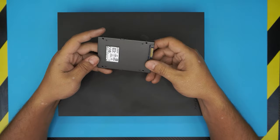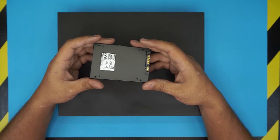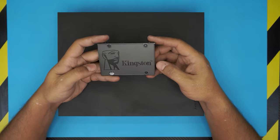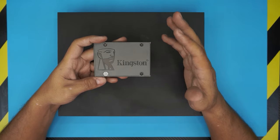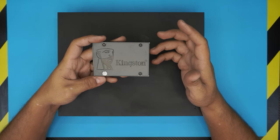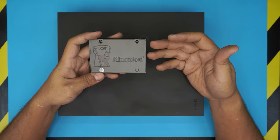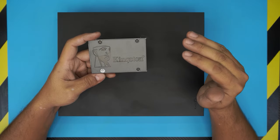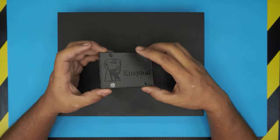I'll leave the link in the description to a few solid-state drives that we have tested and work fine. You can put up to a one terabyte or two terabyte solid-state drive — it all depends on you. Once you put the new solid-state drive in, when you turn it on it's not going to go to the dashboard because there's going to be no operating system. I'll leave the link in the description to an Xbox website where they show you how to load up your new system fresh from a USB stick, with step-by-step instructions on how to load up the new dashboard if you replace your hard drive. And this is what we're going to do today.